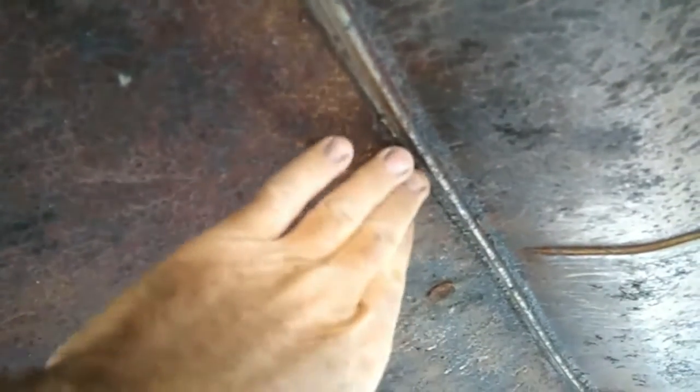Look here in this area, typically in this area here, to make sure that there's no rust holes. If there's a rust hole, make sure you treat the area, because it rusted from the inside out. Treat the area from the inside out, so when you open it up to weld a piece in, treat it, shove a brush in there with rust reformer. You can use phosphoric acid, but it's better to use something that protects it as well.